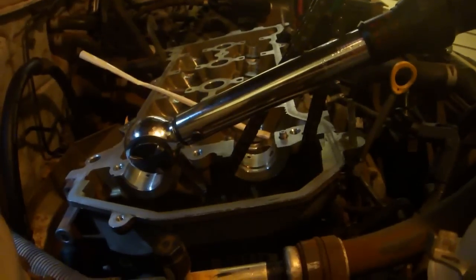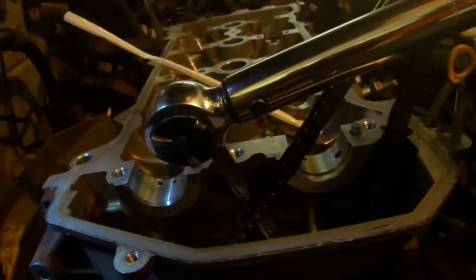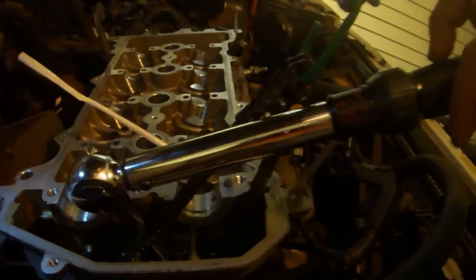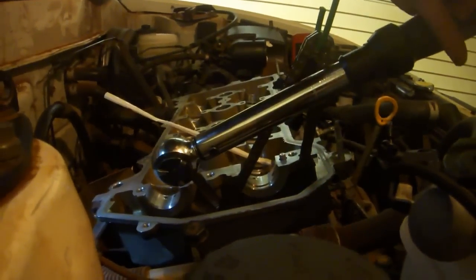Here's what it looks like in practice. You have your combination wrench attached to the head of the bolt. Put the timing chain on the inside of the torque wrench, but on the outside of the combination wrench. Make sure you have your combination wrench and your torque wrench at a 90-degree angle. And when you push down, make certain you're not pushing toward the ground, but rather you're pushing at a 90-degree angle to the handle. Otherwise, it's exactly like doing a normal torque.